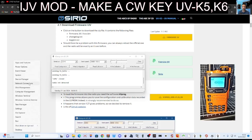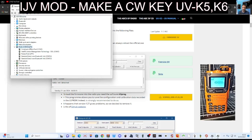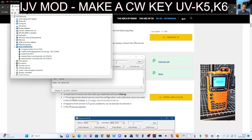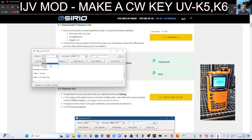Let's right-click and open Device Manager. Double click. It's changed COM port — let's find out. Plugging in and out... see what I mean by these cables? They just play up. There it is — pushed it in a bit harder and it's appeared now. Go back to the software, select COM11. Now you can actually read the configuration by clicking Read, and write it. Read calibration — that's how you do your backup.